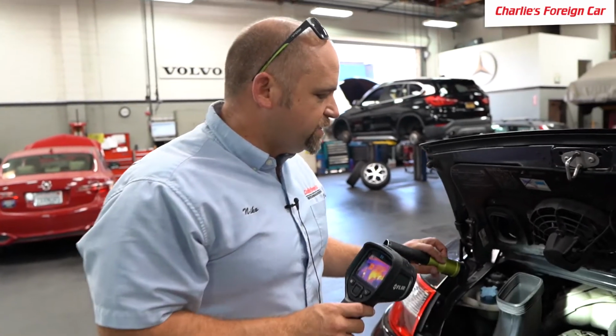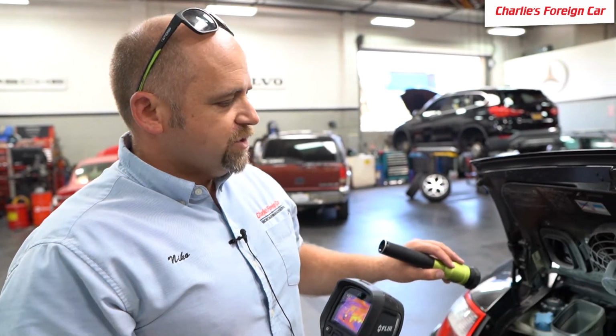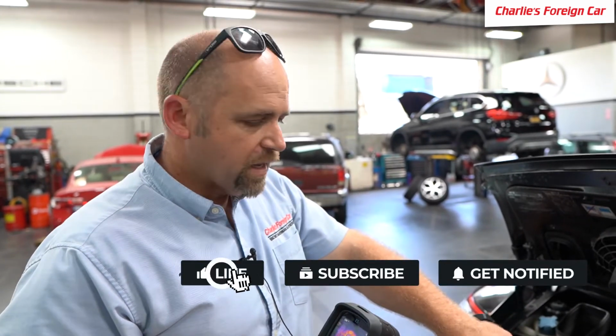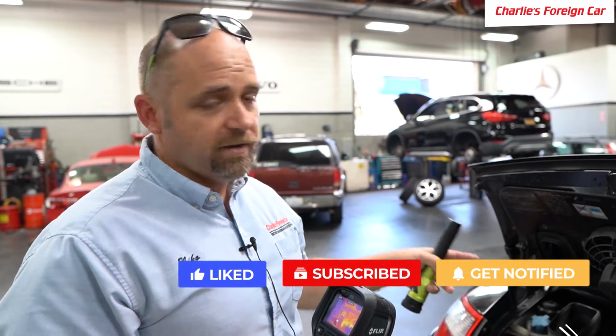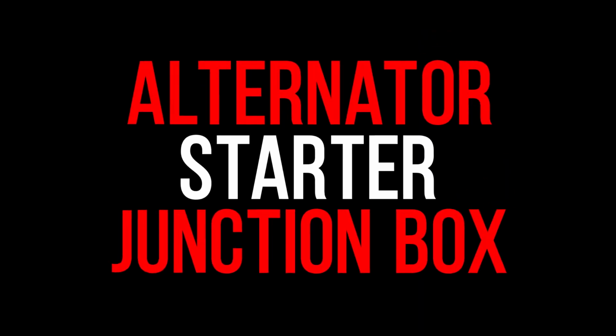Now what we're gonna do, because it's really difficult to access the back of the starter with a voltmeter while the car's running, is complete the circuit from the bottom, from the transmission, back to the alternator. So we know that the alternator is good because we have 13.9 volts coming out of the alternator. We know at the junction block, at the transmission, it's bad because we have 12.5 volts. The connection is bad somewhere in between the alternator, the starter, and the junction block, and it's above the junction block.